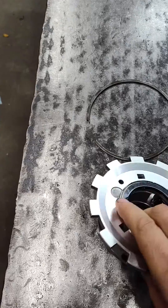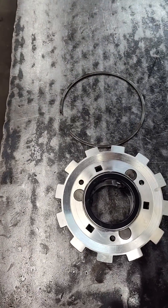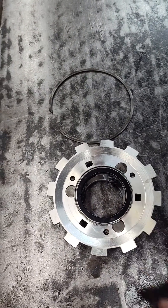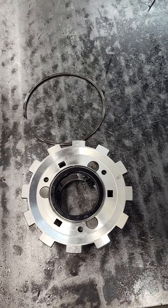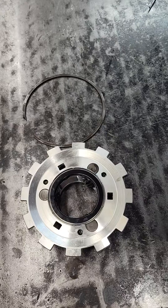I put the bearing on both sides so you don't have to buy a hub or anything else. If you want to put roller bearings in these two positions, you just need this one part. I make it stock height, so you may just need a set of selective thrust washers to fine-tune your end play, but for the most part this just fits.